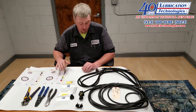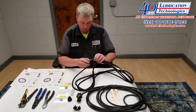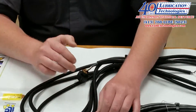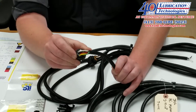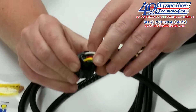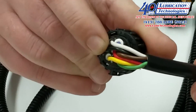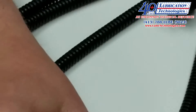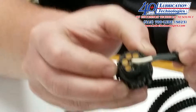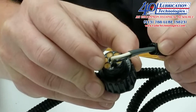There is a seven pin connector so you have on the back side options of one to seven. When you're using a seven wire cable you will end up using all seven ports, complete with liquid tight seals to prevent water intrusion. On the two wire cable we'll only be using two ports and the rest will have blanking plugs to complete that watertight seal.